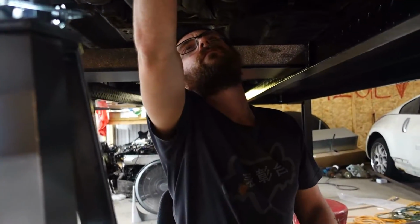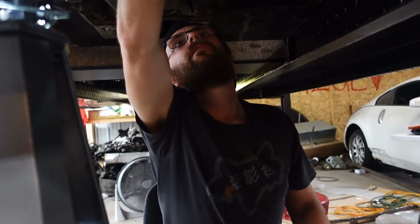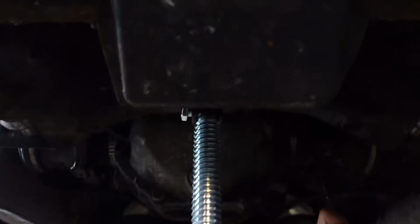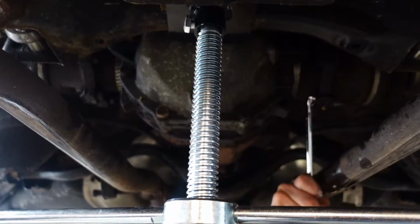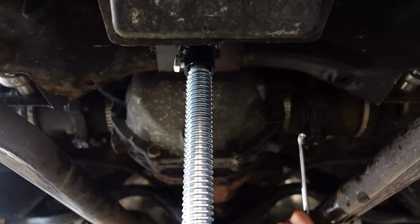Well guys, sometimes things just aren't what you want them to be. So CJ, show them what your welded diff is doing. That ain't very welded, is it? But it was. So that's a big bummer, because this was somebody's drift car, and it was a welded diff, and now like it acts welded sometimes, but it's got a huge void where it can like move back and forth. So the welds have probably broken. We'll get the diff out and open it up.